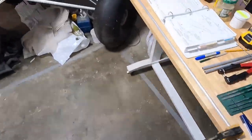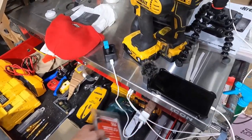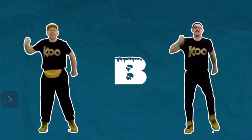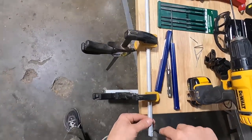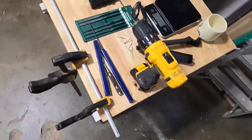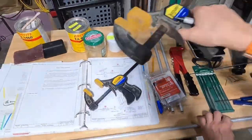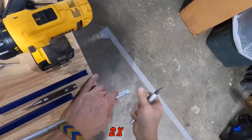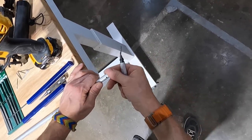Very light pressure on those — just let the bit do its work. Otherwise you distort them quite a bit when you push down on them. So we'll do a little deburring, because we love deburring, right after we drill. Takes the burrs off so that we don't cut our safety wire or our fingers — not so much our fingers, but probably the safety wire. Deburr this end a little bit, or it's going to rub up against the fuselage.